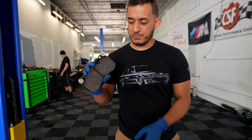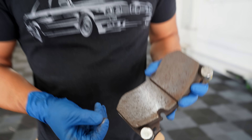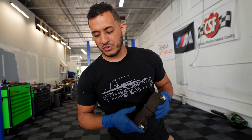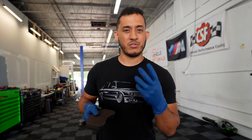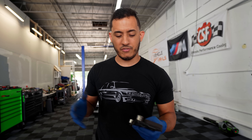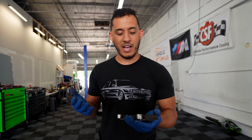Anyways, I did notice something - these brake pads, OEM ones, only about a thousand miles on them, are very cakey. It seems like they've fallen apart for whatever reason. I do know that BMW switched over to a softer compound with their newer M cars, but there's two big cons. A lot of people are experiencing the issue that I'm experiencing where the car vibrates up front. Also you get some freaking loud squealing like a big train trying to stop.